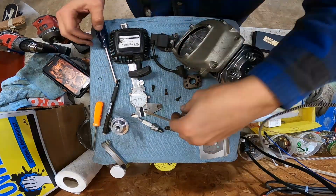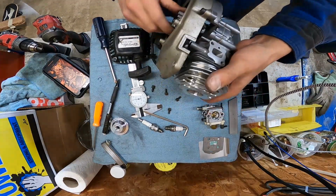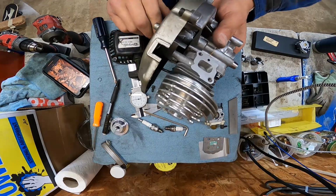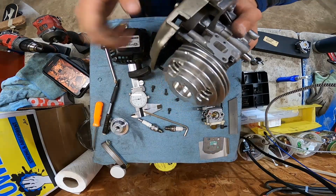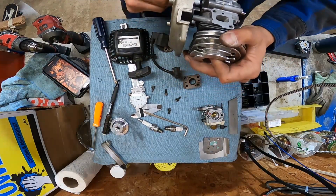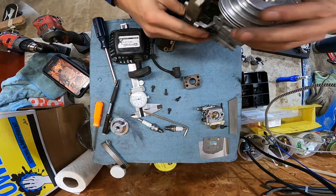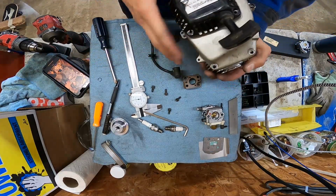This is the fan cover off my Sport, but yeah, we got full rotation now, so ain't nothing to worry about no more as far as things hitting and things getting stuck. This is, again, an original G23LH OEM piston, I believe, when these were manufactured by Komatsu. When the compression is good, I put my finger over the hole and I can't really turn it. So that's good. This thing spins now, and that's what we were trying to achieve to begin with.